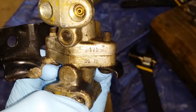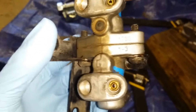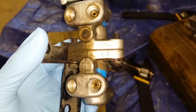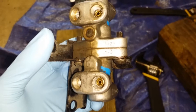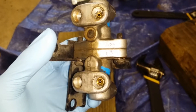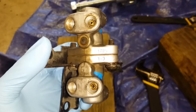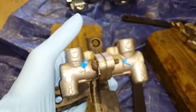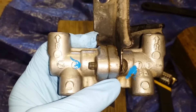The Civic HF valve has an H16 on the bottom and other stamps. This other valve is also a 1725, stamped T3, and it came off what I believe is a 92 to 95 — possibly up to a 97 — Del Sol SI, not VTEC, with either a D16 Z6 or D16 Y8 single overhead cam engine, and it had rear disc brakes. Both are 1725, so you'd think that's probably what I need — and this is maybe a better option based on the weight. But if you look at the back, there are other codes and stamps.